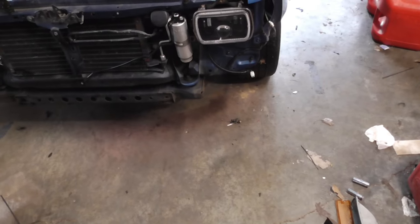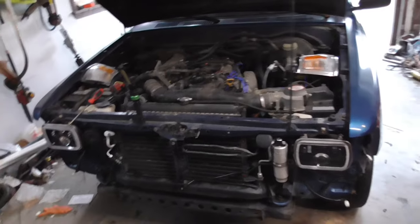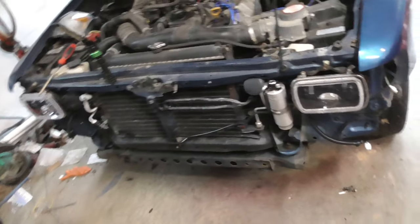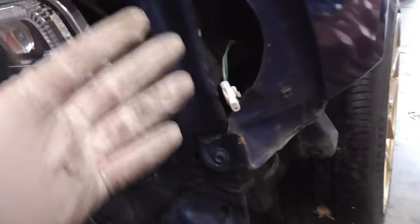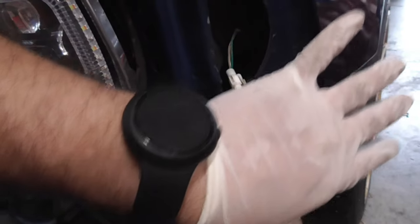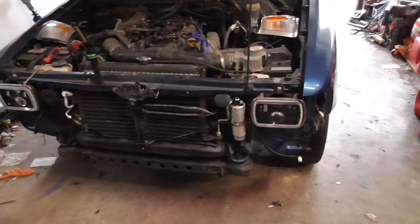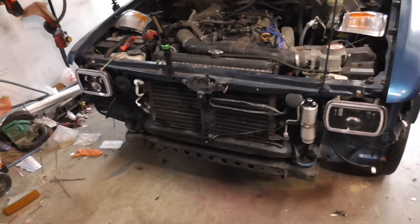You can see a little bit more of the damage in the front. The bumper took most of it, which is thankful. The fender got some and then that got some, and then there's the whole deal with the rear end and the frame in the rear, but that's not what we're dealing with right now. It's not too terrible - it's something I could fix right now if I wanted to, but I'd have to bend the header panel back straight, the fender back straight because it's all crinkled, and also this bracket back here that holds the fender is also bent.